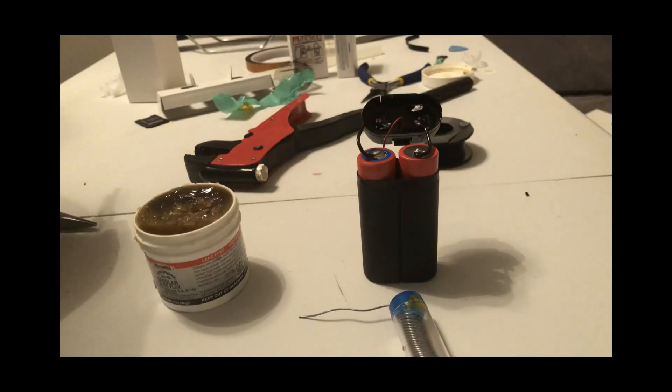Alright, I'm going to save you guys some time here. Basically I wired it all together and it all seemed fine — all the voltage seemed perfect — except the issue is there's just too much wire. The wire is pretty thick so it wouldn't close all the way, giving it a little bit of height, and it wouldn't fit all the way into the drone. So I'm going to have to try again with some smaller wire. I did get a weird spark on the board so I have a feeling I might have fried something. We'll see — I'll open a second battery if I did. Stay tuned till the next video.